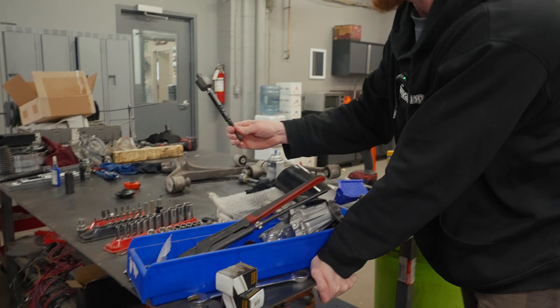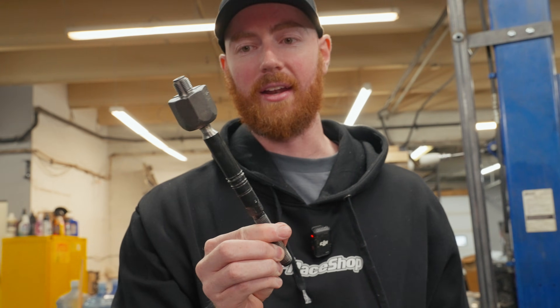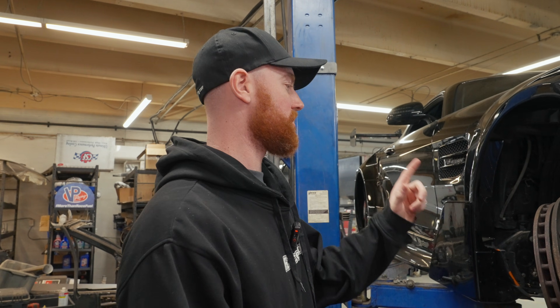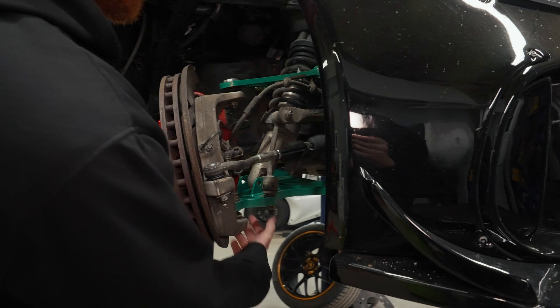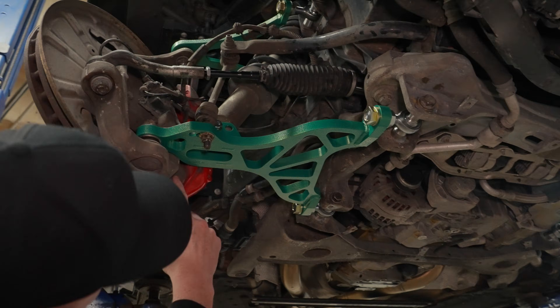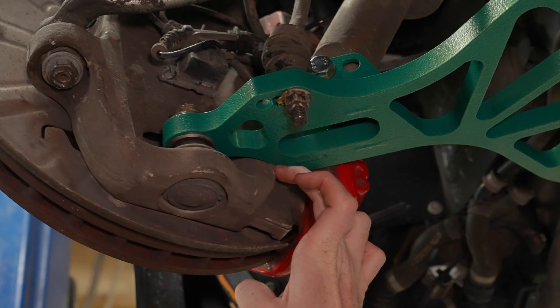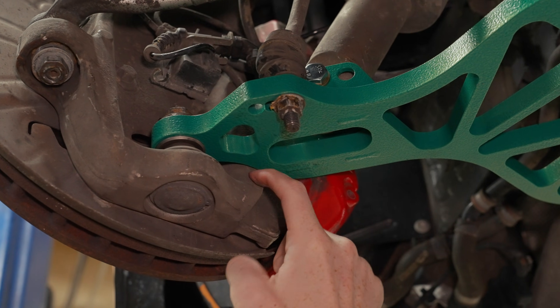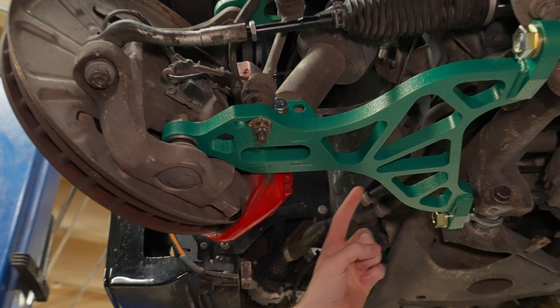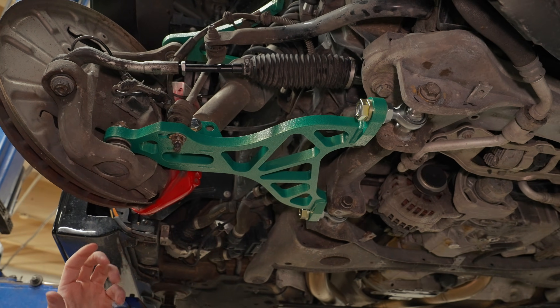I don't even want to know what the Mercedes one costs, but they look identical. This is the Mercedes inner — absolutely nothing special about it, but it might cost you $250 because of the symbol. There were actually tons of tie rods that could have been used — Hyundai had various ranges. The car actually gets quite a bit of lock, and the knuckle just maxes out right here on the control arm just before the caliper hits the control arm and just before the wheel hits the control arm, so we have a perfect factory bump stop.